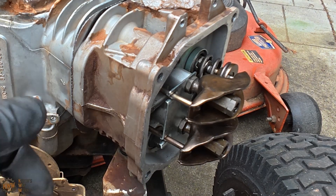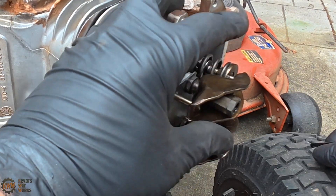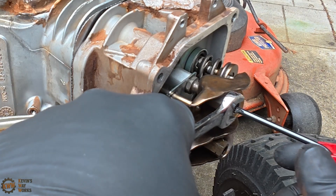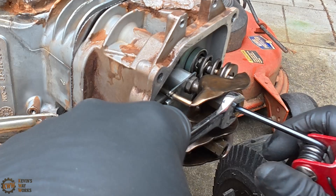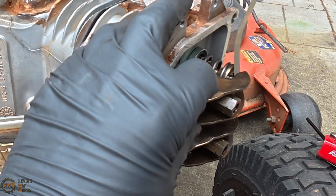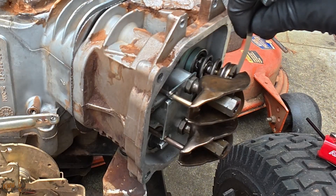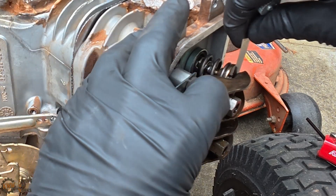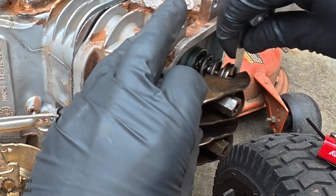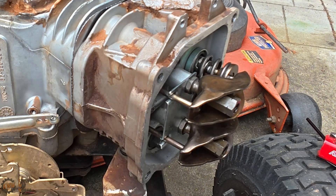Specs say between 0.004 and 0.006. Let's tighten this up just a tiny, tiny bit like that. Let's tighten this down. Let's try 0.005 again. So now we're a little tiny tight. It's a little tight — it's got a little more drag than I would want.